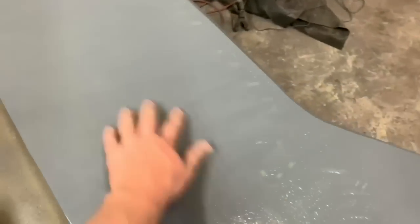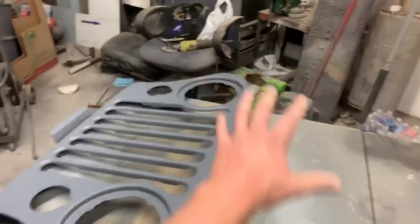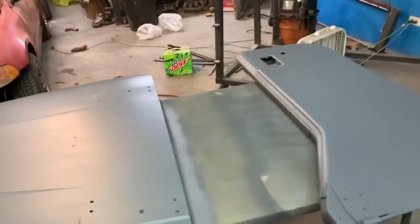So I'm gonna grab all the black Rust-Oleum half cans that I have, and I'm gonna spray all this. This clear needs a little more time to dry before I can actually dig into it and take it off. So I'm gonna just dust all this in black, just a real quick light coat, let it dry for probably half an hour, and then I'm gonna sand it.